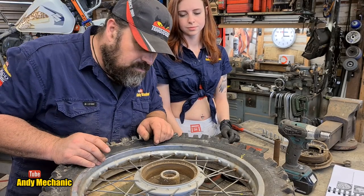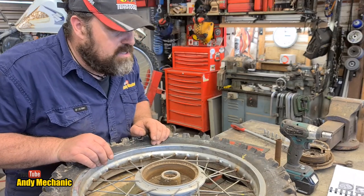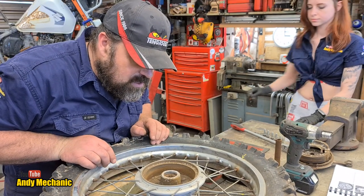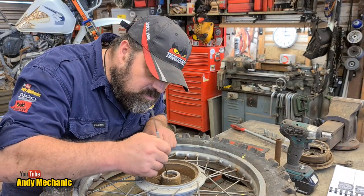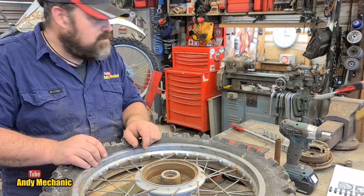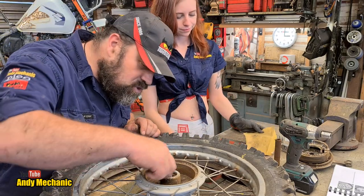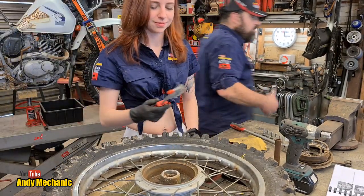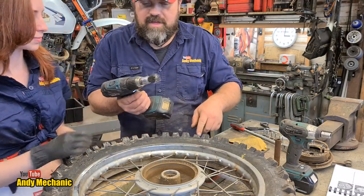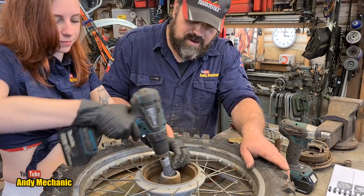Go grab the scriber again from that top drawer. I think I chucked all the sandpaper away, so we'll need a little bit of sandpaper and maybe a wire brush as well — just to clean it all out and get rid of all this bloody corrosion. Attack with a wire brush first. In actual fact, I've got a special tool — just poke it down the hole and give it a wiggle round where the bearing sits. That's the main thing we're interested in, where the bearing sits.